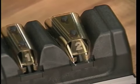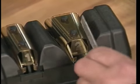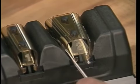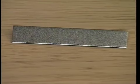To dress the wheels, turn on the sharpener. Insert the dresser between the plastic spring and against the knife guide, just as you would insert a knife for sharpening. Make contact with the honing wheel and pull the dresser plate through like a knife. Pull twice through the right and left slots as shown, taking 2 to 3 seconds for each pull. Use this tool only in Stage 2. Never use it in Stage 1.